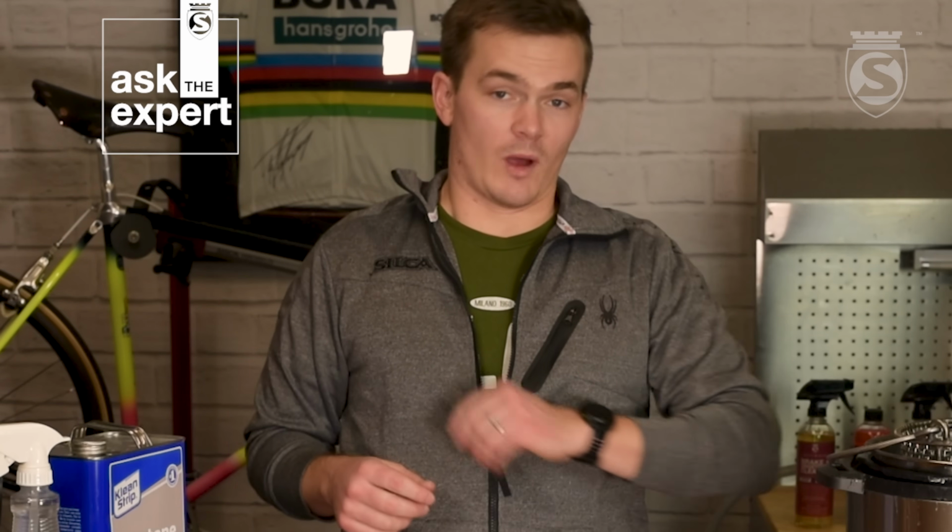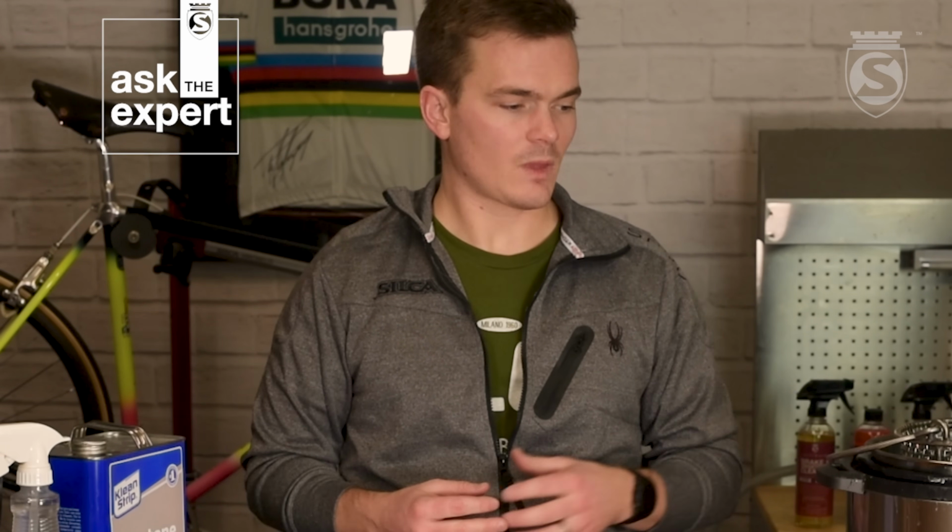So wipe it down, use a gear wipe, and a degreaser would help drive some of that out. Then you want to make sure that you get that off of there, and get it back into wax or drip on Super Secret as quickly as possible and let it dry, so that it's driving out the water with the emulsifiers or with the hot wax. That way you're not getting any rust.